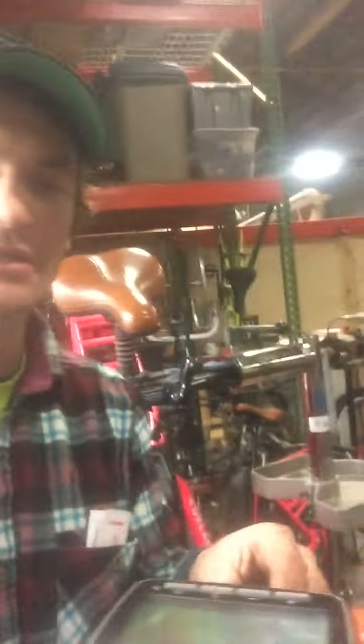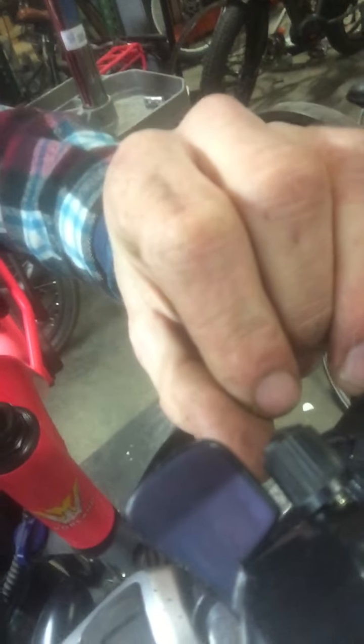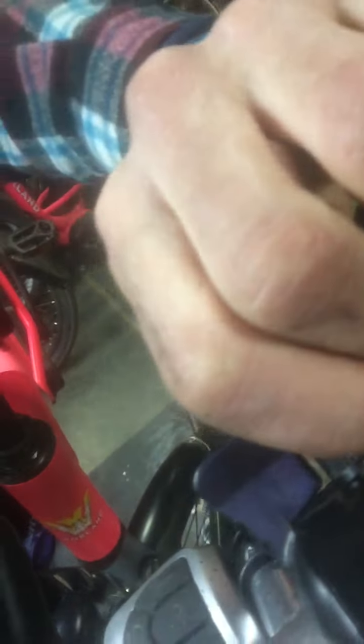You might be concerned about someone in your area who's the 'fun police' — they'll still see a throttle on your bike and have a problem with it. So I've made a modification to the throttle on this bike so that it sits above the handlebar and grips, making it easy to remove. I added a little thumb screw, so all you have to do is loosen that screw, the throttle comes right off, and this bike is fully a Class 1.